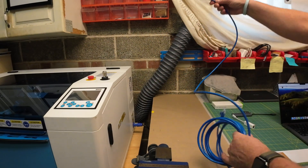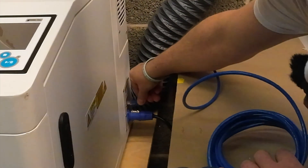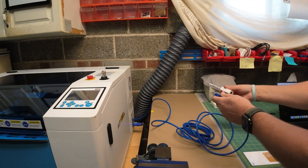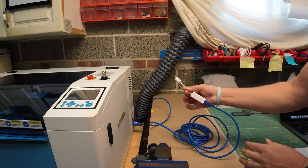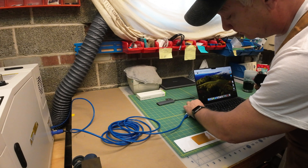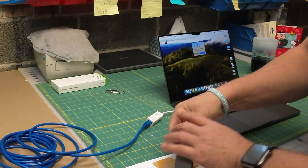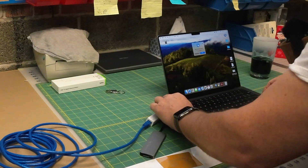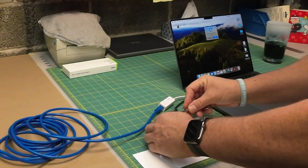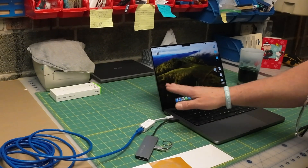Take your Ethernet cable and plug it into your Bolt until you hear the click. Take the other end, connect your adapter, and plug it into your Mac. Then grab your USB adapter, plug that into your Mac, and take the thumb drive you received with your Bolt and connect it to that adapter. You now have your thumb drive and all its information connected as an external drive.